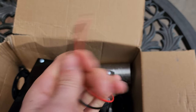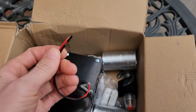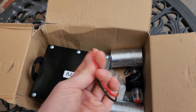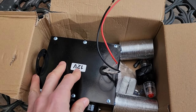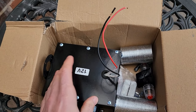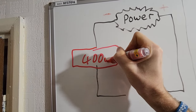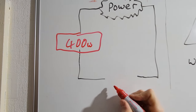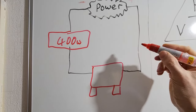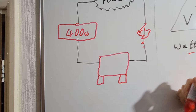Once we know the power requirements for our device, we can select the appropriate wire, and then - and only then - do we select a fuse. The fuse is designed to protect the wiring and circuit, so always get the wire first and fuse afterwards. This heater hasn't supplied us any wiring to the battery, just two little terminal ends, so we need to supply our own wiring. I'm going to assume this is a 400 watt heater and I want to put it around five or six feet from the battery. Let's calculate the gauge of wire we need.